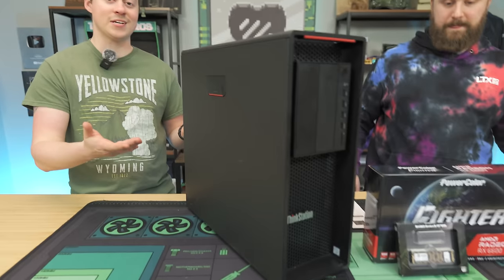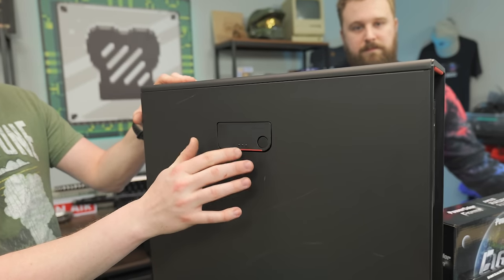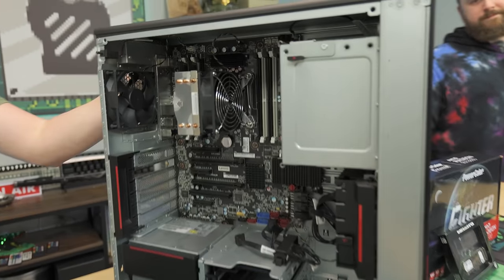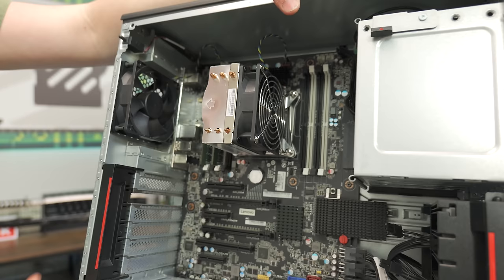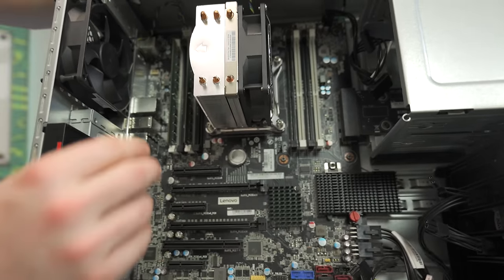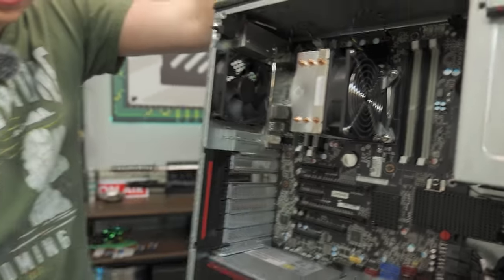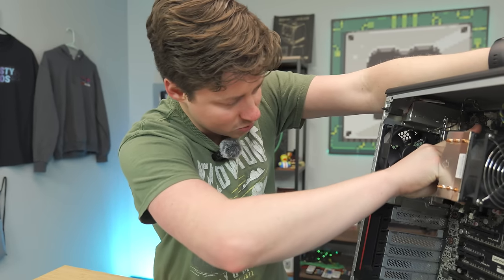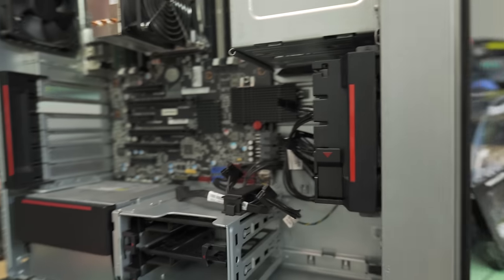The best part about this system is it's a full system that's literally ready to go — we just have to add a couple of components: a graphics card and an SSD. The P520 is a Lenovo workstation PC. These were really expensive back in the day, but now they're all over eBay in the $100 to $200 range. This one comes with the W2135, a 6-core 12-thread processor under a gigantic tower cooler built into the case. You get a total of eight RAM slots, and we have two sticks of 16GB DDR4, which is great because a lot of cheaper workstations use DDR3. These systems also come with 6+2 pin connectors — it has two of them, so you can use a pretty nice graphics card.